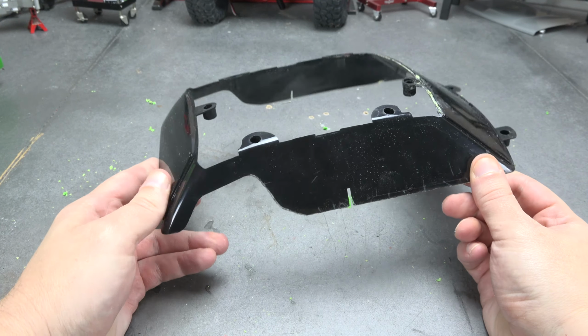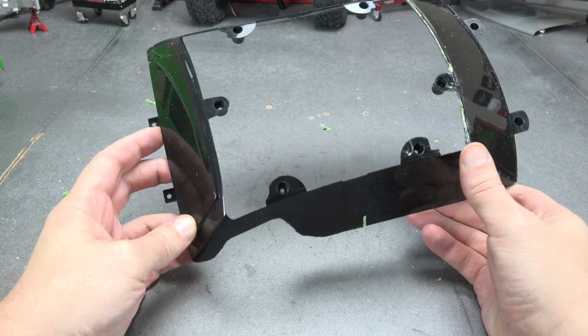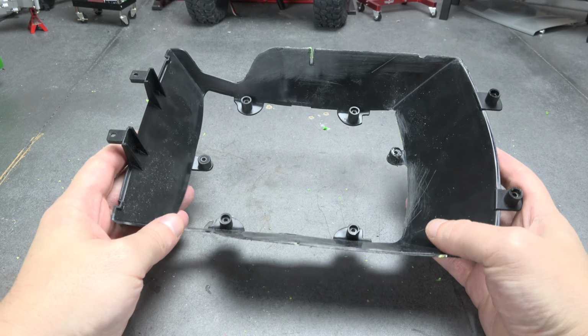It turned out a lot of the glue was old and brittle and was easily removed. But what wasn't old and brittle was the glue holding the window unit in. You didn't see it in the montage, but I rage quit many times. I spent hours sanding the glue off of those windows because I didn't want to damage the body or the window unit. This window unit is irreplaceable, and I'm going to need it when I mold new windows, so it's imperative I don't damage it.